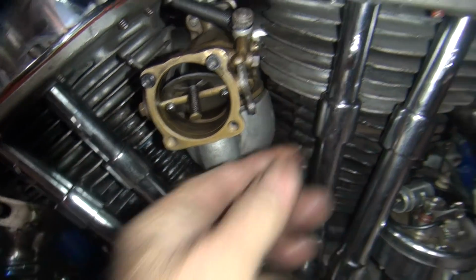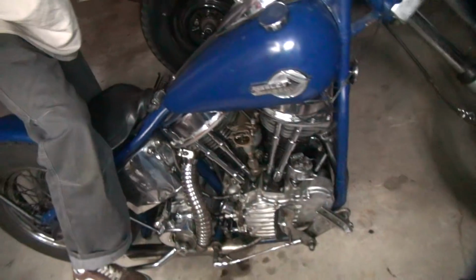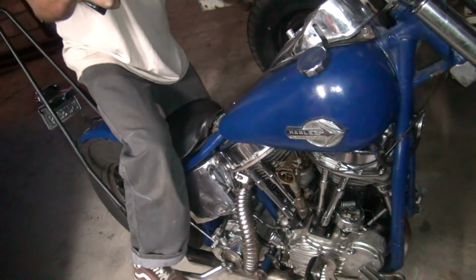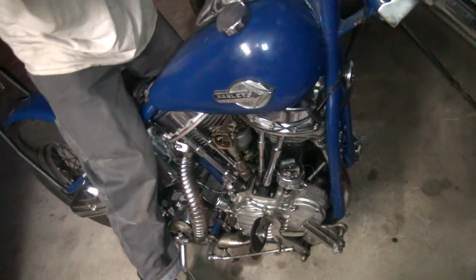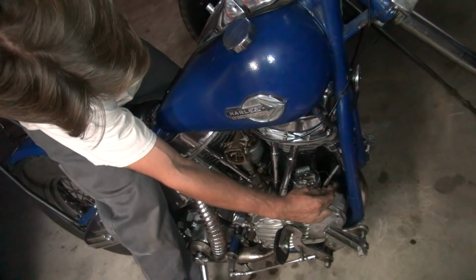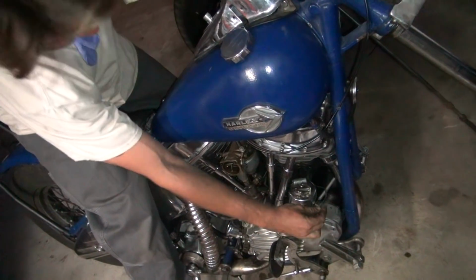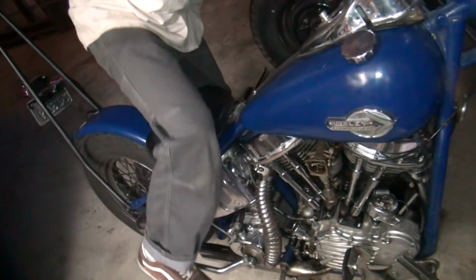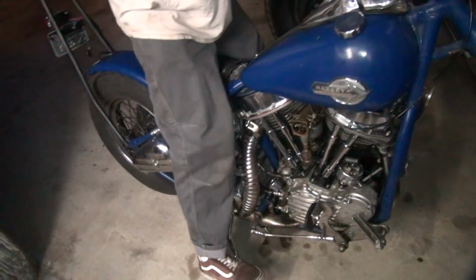Give it half choke. Throttle full still. No, close the throttle. All the way? All the way. Okay. Did you retard it any? No. Retard it slightly. 1/4 inch. Get 2 hands and move that one. Okay, that's good. Okay, we're just going to crack it a little bit. Maybe, I don't know where you're at. We'll figure it out. Fire in the hole.